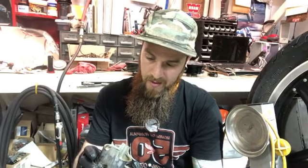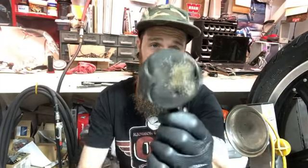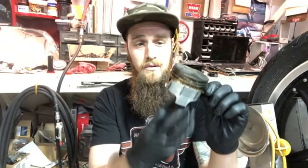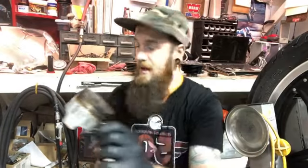There was some overheating going on underneath, but not a crazy amount. It was all really up top, which is why I don't think of a lack of oil type situation. Usually the bottom of the piston will just be black, and the oil will be burnt to it and overheated. You can tell. This one looks like it was overheated from the top. So, lean condition.